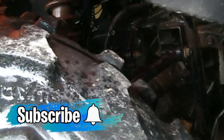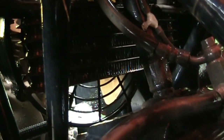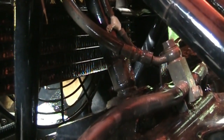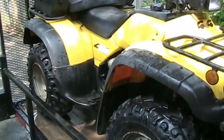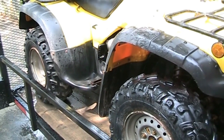I got the cooler hosed out — it looks a lot better now, no more big clumps of mud. Should be enough cooling; the airflow through there, the fan's good. A couple of things you just got to check before you ride your bikes: oil level, fuel level, check for little things like cooling. If you do those little things, the bikes will last a lot longer.